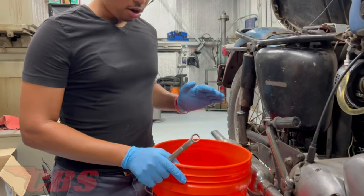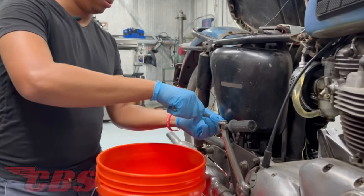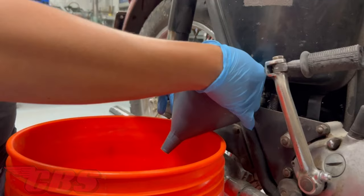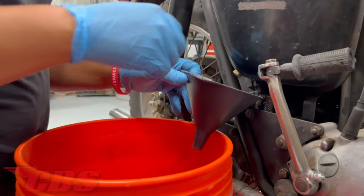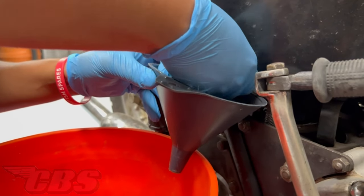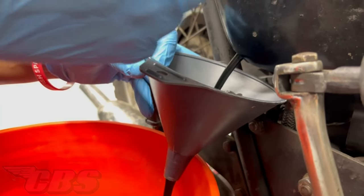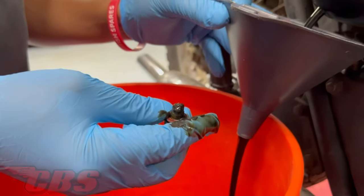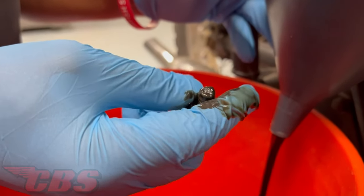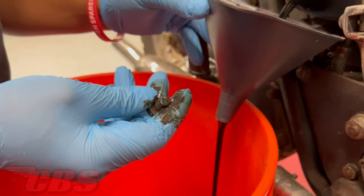Now we're ready to remove the oil. We got our bucket and funnel. We're going to loosen up the drain plug — it's not too tight. This one is pretty cool: it has a magnetic plug on it. So if there's any fuzz or debris floating around inside your oil tank, it's going to catch all that. The oil should be nice and warm so it should flow out nice and easy. With the oil being drained, we can check the quality of the oil. There's a little bit of fuzz — it's got 5,000 miles on the motor. On a new motor, you get a little bit of piston ring buildup and things of that sort. That's going to be on a magnetic plug, so that's not concerning. The more frequently you change the oil, you'll start to see less and less fuzz.